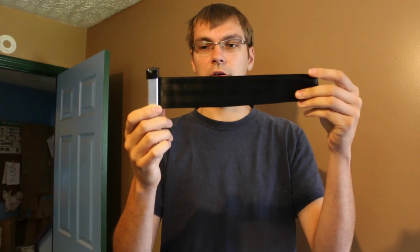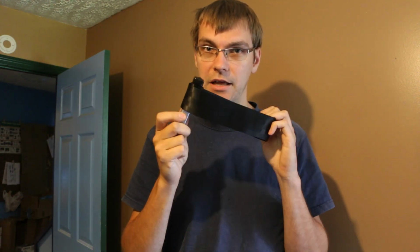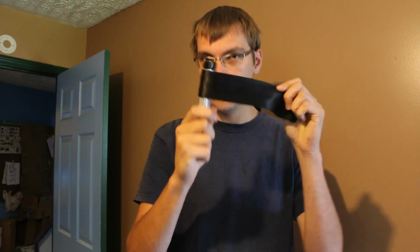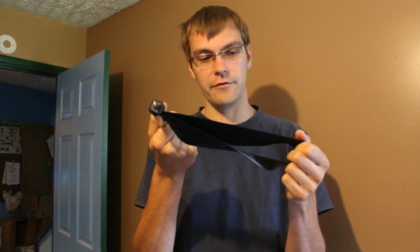A strap oil filter wrench. You put a 1/2-inch ratchet in this end, and you wind this thing around a spin-on oil filter, and it will take it off. I guarantee you, you will never find an oil filter that will not come off with one of these. I have crushed them to half their size with this, but they always come loose. And you can use it for so much more than just oil filters too.